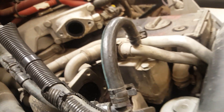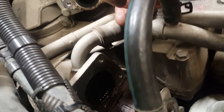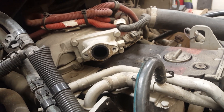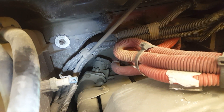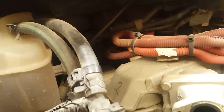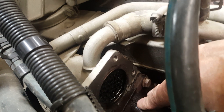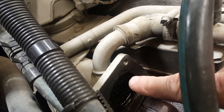There's a direct pipe from the cooler to the intake and the EGR valve. I'll give you some light here — it's at the back, way back there, and that controls exhaust flow. The direct exhaust connection at the bottom of the cooler goes to the back to the EGR valve, and then it opens up and back to the intake end.